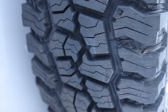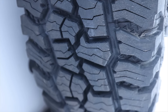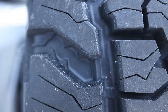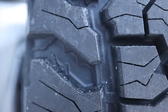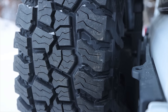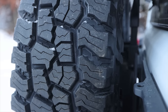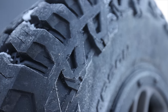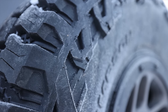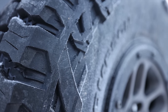To me, this tire is a great example of this new generation of hybrid tires. This is clearly a combination between a mud terrain and all-terrain — tighter spacing than you'd see in a really aggressive mud terrain, but it's definitely designed to clear. You can see these little features in between the lugs designed to help it clear when you're in mud, but clearing is not great when you're going through super deep powder. You want a tire that holds on to the snow.